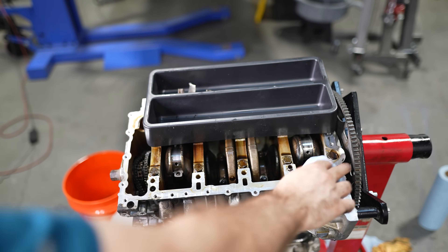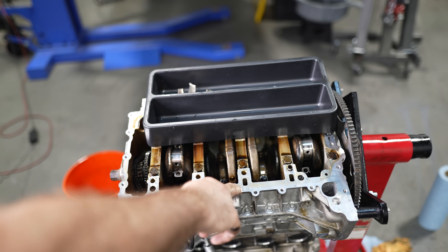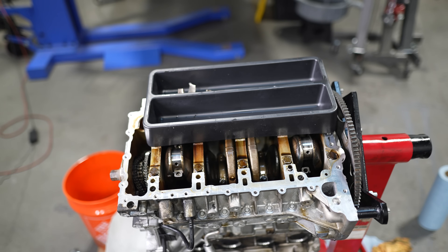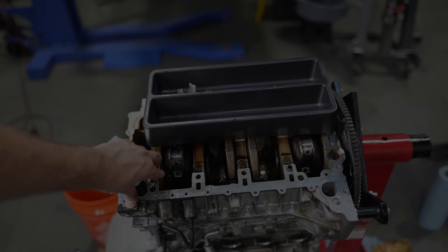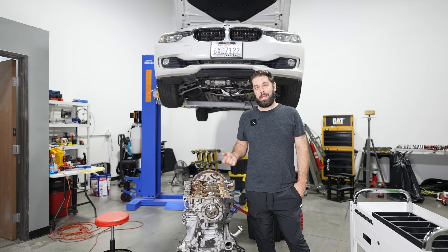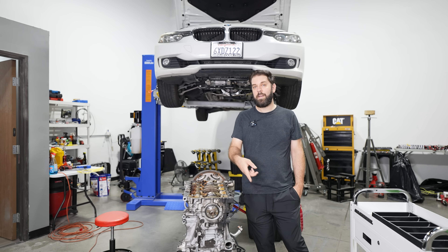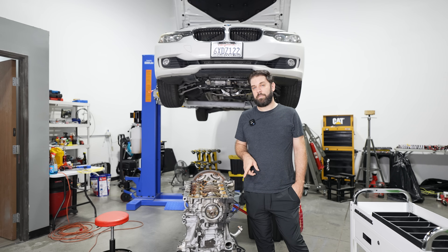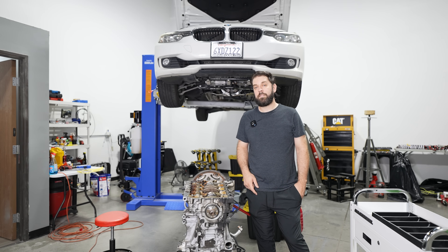As soon as we get this motor running we're going to be flushing it within two to five minutes — flush right away. It was in the early stages of failure; it didn't throw a rod out the block, it didn't seize right up. Whoever was driving this decided to pull over and leave it on the side of the highway — it gave it a chance, and that only matters if you're rebuilding the engine. In part two, we're going to be taking the crankshaft out, disassembling the engine, dropping the crankshaft off at a machine shop, doing main bearings, rod bearings, front and rear main seal, and installing the updated timing chain guide and new chains to make this thing as bulletproof as possible. It only has 97,000 miles on it, so we want to make it do another 150,000. If this is the first video you're catching, please consider subscribing, and if you liked it give it a like. Thanks for watching.